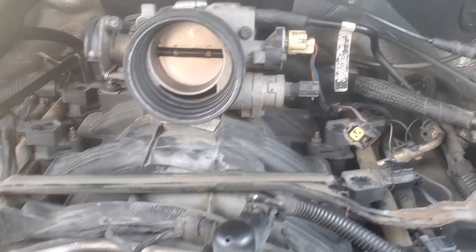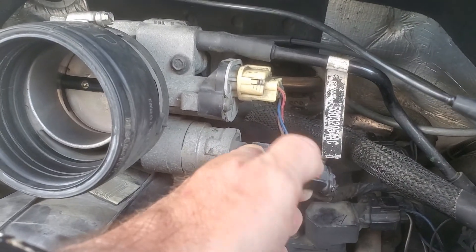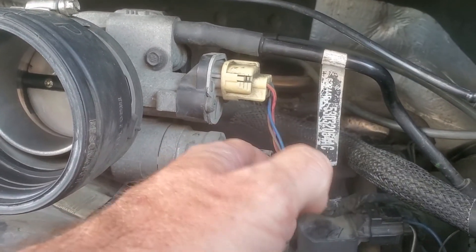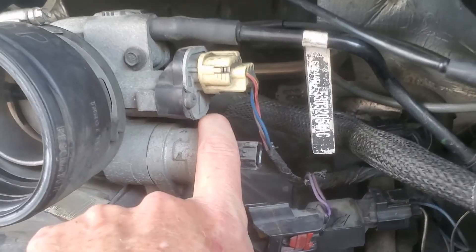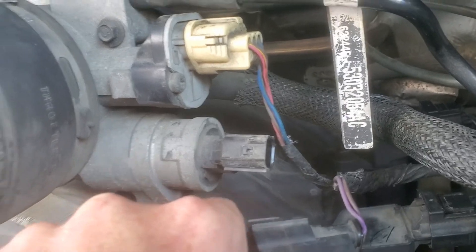To give you a better angle here — just pop this little red clip off, push this little black button that's right there, and then just wiggle this right off. Then there's a torx there and there should be another torx right up in there, so we'll go ahead and remove those right now.